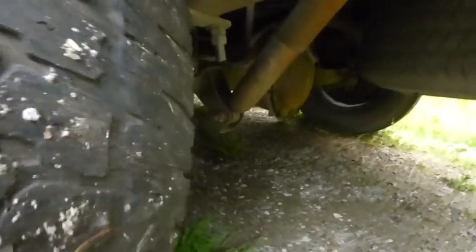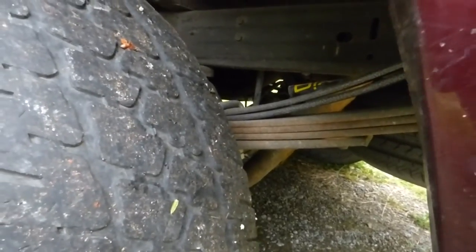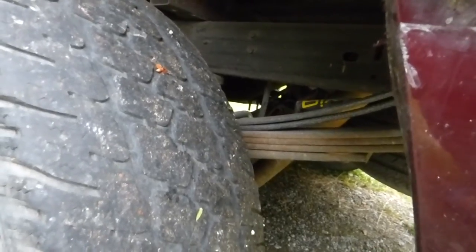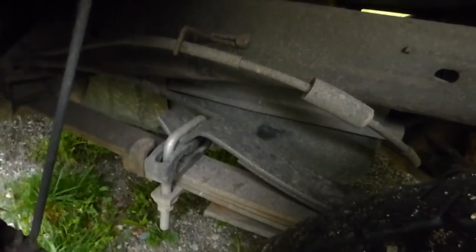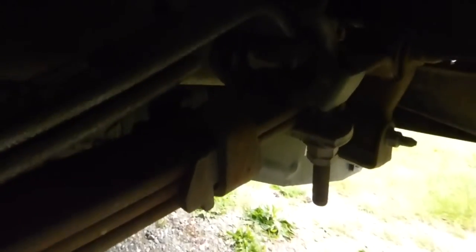Something I hadn't shown before was I had put an extra leaf spring on — actually it looks like two. The rule of thumb when I was a mechanic was 250 pounds per leaf spring, but I think they rate this one a little more. They're pretty full length and also quiet, which most are not. They have a little rubber piece for dampening; otherwise they would be noisy without a load.